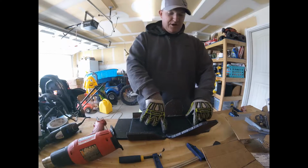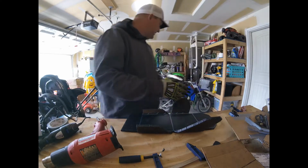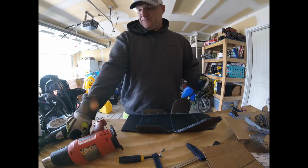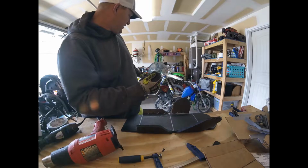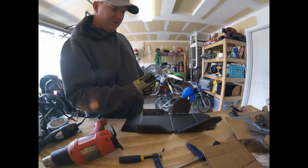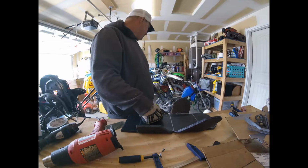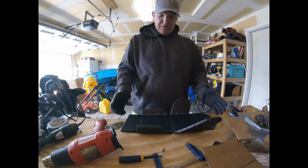These two lines right here are going to be our next two bends, and so we have to bend this basically to fit the contour of the Husky. So I've taken my handy dandy protractor and I got this center line with the bottom. So this first bend on the bottom is actually a 45 and the very top bend is a 25. And we've got to kind of account for the radius down here in the middle. So this bend's going to be a little bit bigger.